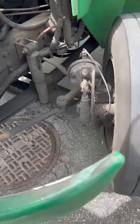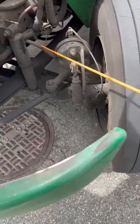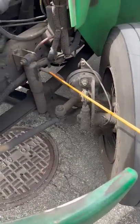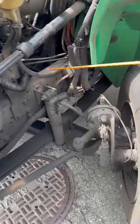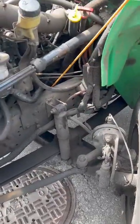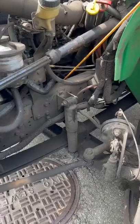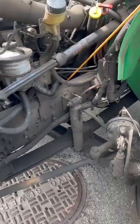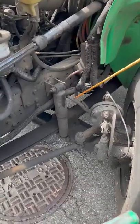Now I'm going to do my air suspension. My air pressure hoses have no abrasions, bulges, or cuts, no audible leaks. Following them through my frame into my engine takes me to my air compressor. My air compressor has not been broken or cracked, it's secure to my engine, all mounting bolts present, it's gear driven, no audible leaks. And my hoses have no audible leaks either.